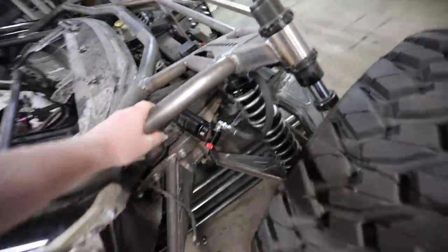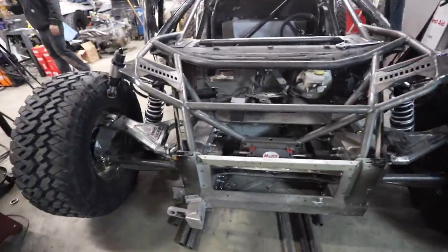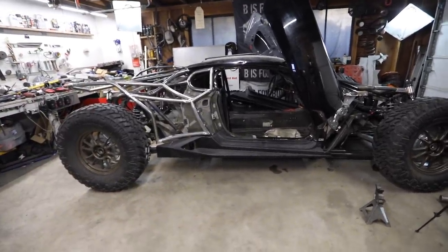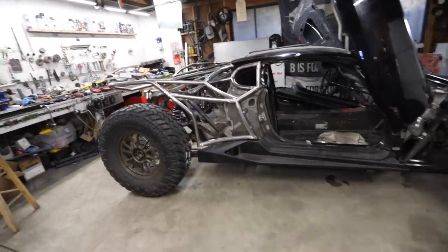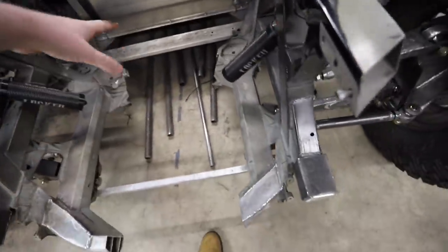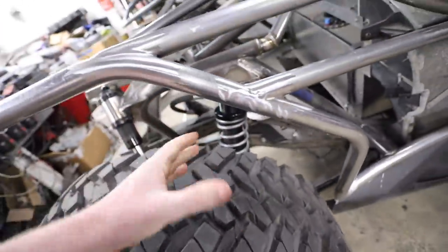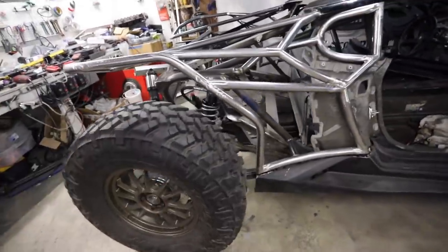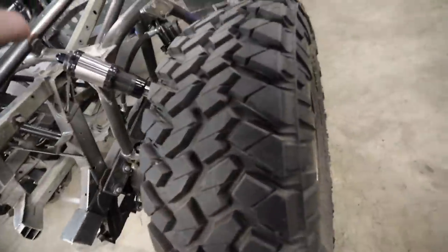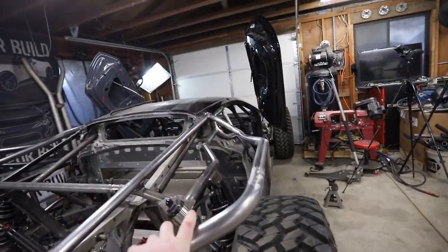Front springs went really quick now that we kind of know how to do it. So we are fully suspended now, car is sitting at its ride height, but this is also somewhat adjustable. This is looking exactly like the way it was engineered and the way it was designed, so I think that is a good sign. But we still have lots of weight to put on — engine and transmission transaxle back here. When we all three stand back here, it's sagging a little bit, which means we're going to need to change the preload on this spring to raise the back up a little bit higher. Now that the car is a roller, it's pretty simple to roll it forward. I could just do it with one hand. First car crash — actually that door is really fragile, I don't want to break it.